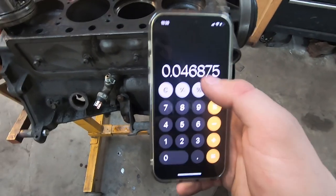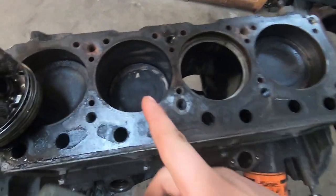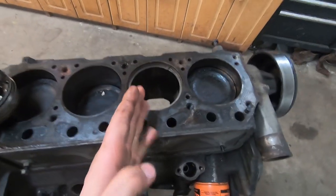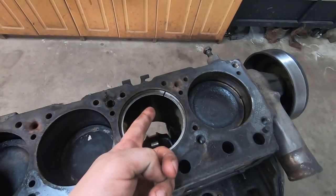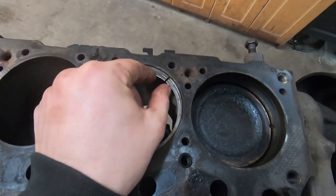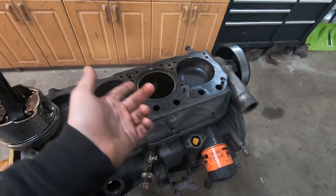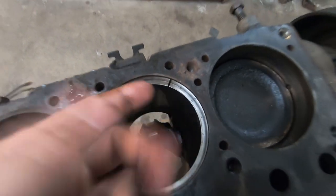That ring gap is a little excessive — I'm gonna say it's probably 0.050 plus. That is really worn out. This thing would have had a ton of blow-by, which explains all the burnt garbage on the cylinders. That amount of gap is pretty evident why this little engine was able to handle 18 PSI. You gotta consider all of these pistons probably have about the same ring gap, meaning there's not a very great seal going on in there. Basically if that gap is too tight and you're trying to make more power than stock, you're gonna make more heat, and more heat expands these rings causing them to butt up and usually destroy an engine. Usually what you do is file your rings to have a bigger gap so you can make more power. I thought it was fine being that this engine has high kilometers, and I think I was right. This was probably the only saving grace for why I was able to put so much boost into this stupid thing.